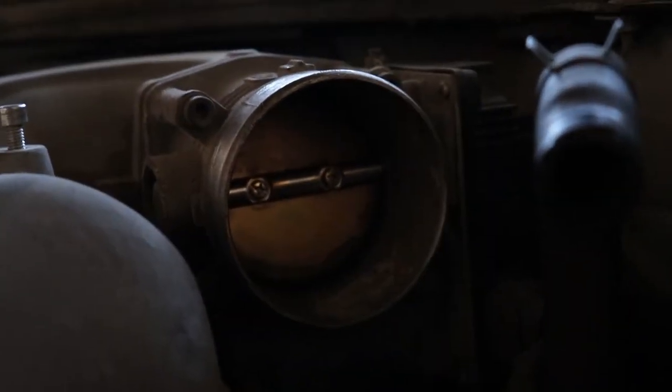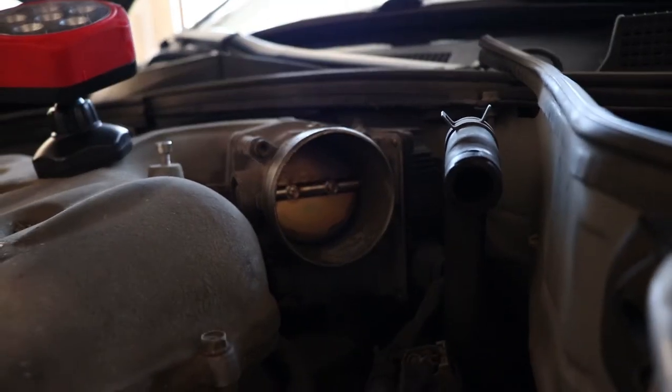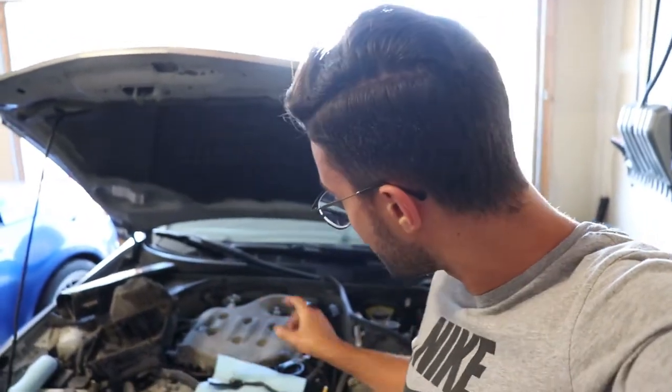We are now going to be taking out the throttle body right here, which you can tell is pretty grimy — it actually looks really caked with tar and debris. I have a feeling that the throttle body cleaner is definitely gonna help out with making this car run a little bit better, but we'll have to see if this is just a gimmick or if it's actually gonna help. Now this part's gonna be important: with most of the newer cars, their electronic throttle bodies, the last thing you want to do is start forcing them with your hand. Be very gentle with how you apply the throttle body cleaner — when you lift the flap, be very gentle. Don't force it; that could potentially break it and give you even more problems.